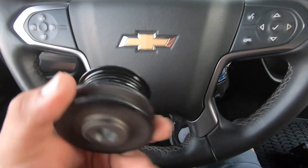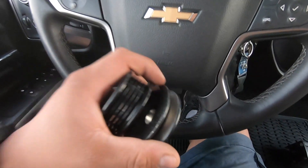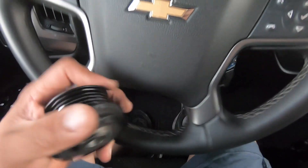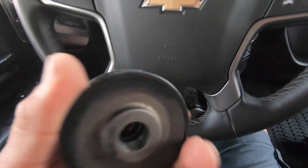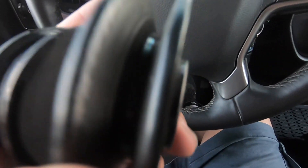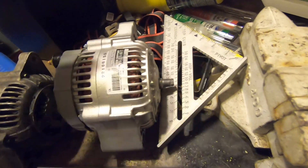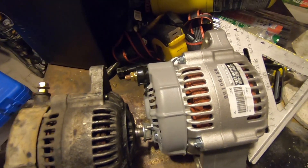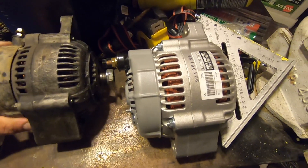We're on our way to a machine shop. The original V-belt pulley has to go on the new alternator — this is a serpentine belt pulley and we have to bore out the hole to the same size. From what I've read online, the hole on this pulley is 17 millimeters and on the Toyota it's 15 millimeters, so we need it opened up. We took it to one shop but they weren't able to do it. I'd suggest going to a shop you know can handle the pulley — we wasted a whole day at the first shop for nothing, so now we have to take it to another shop and they can't get it done until tomorrow.